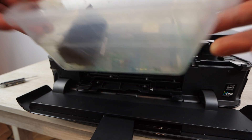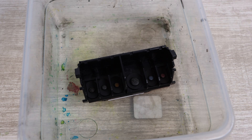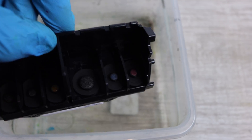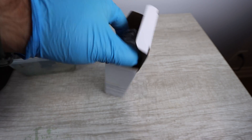At this point, pull out that nozzle report and determine what colors need to be cleaned. You may have to clean all of the colors, or just one or two. You may know off the top of your head what colors are not working, and you can see in the print head which colors are which — you've got black, gray, yellow, black again, cyan, and magenta.